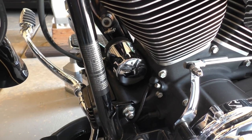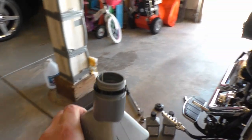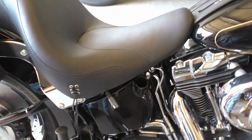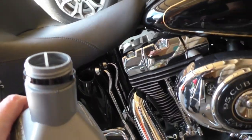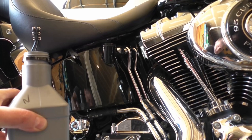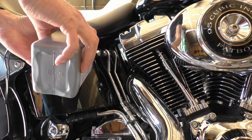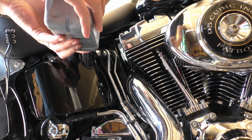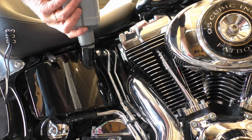I got my filter on and cleaned it up a little bit. Now we're going to fill it with oil. The manual says to use no more than three and a half quarts, but I have never put more than three quarts in. If you put three and a half quarts in, you're going to overfill it. You don't even really need a funnel — you can if you're afraid you'll make a mess — just pour it in. Let it drip for a bit and do that for three quarts.